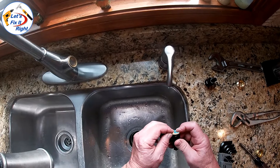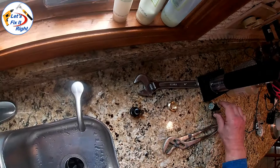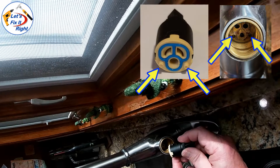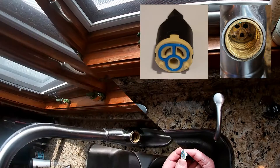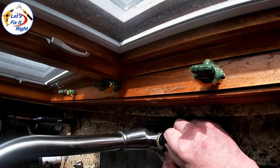I'll place the old cartridge out of the way. These two upper eyelets align with the two holes in the upper section of the cartridge cavity, and these two plastic prongs go into the two holes in the lower portion of the cartridge cavity. With the two plastic prongs oriented to the bottom, we'll now insert the cartridge into the cartridge cavity and slightly rotate it back and forth until we're absolutely certain that the plastic prongs are seated into the holes.